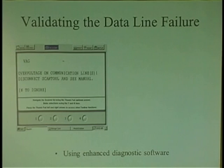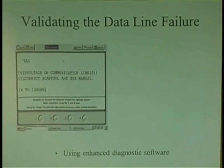You know what I do? I hook this thing up. I put a jumper lead in here and run it to the battery positive. Boop. The box lights up. My tool is now powered up. I don't have time to diagnose why pin 16 is dead. I'm there to diagnose the car.